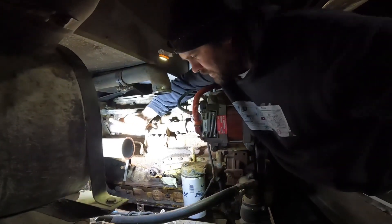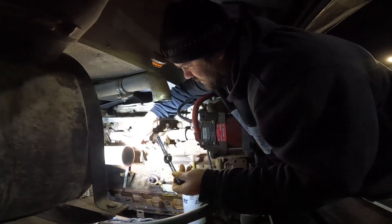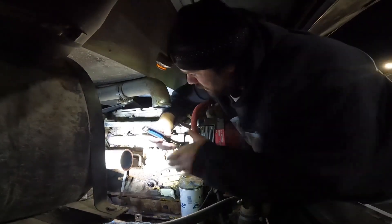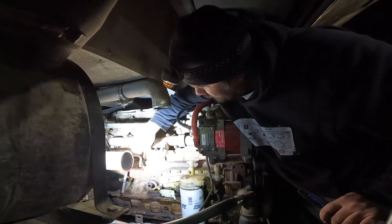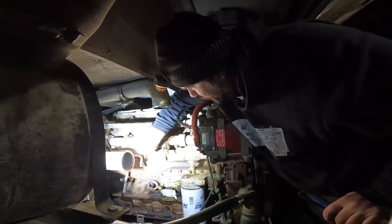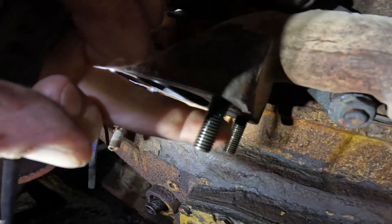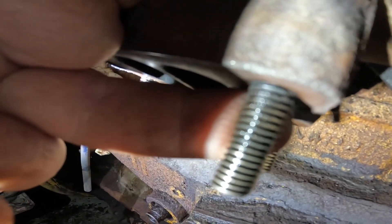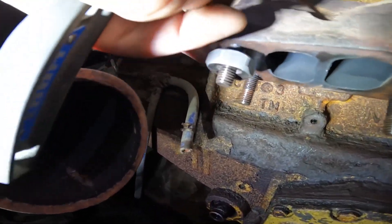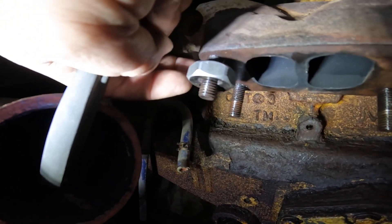Rather than use the tapping die handle, I don't have room to spin it because of the other thread sticking down, so I'm using an adjustable wrench. The idea is to get it to where I can move it by hand freely — if I can, I should be able to slot a nut up the same way. Can we see how clean these threads are right here? These are really clean; this one's being cleaned now. That one with all the gunk on it hasn't been touched yet.